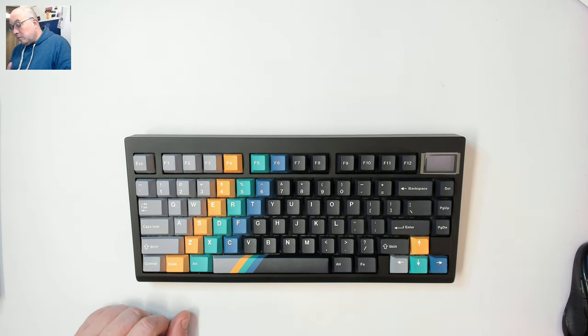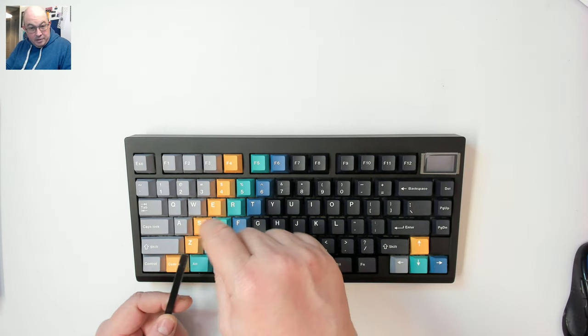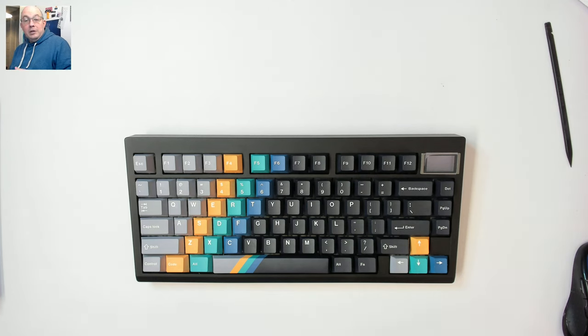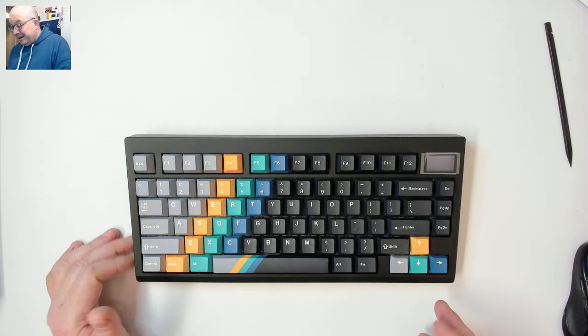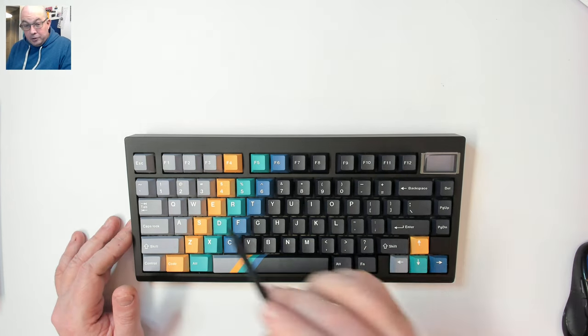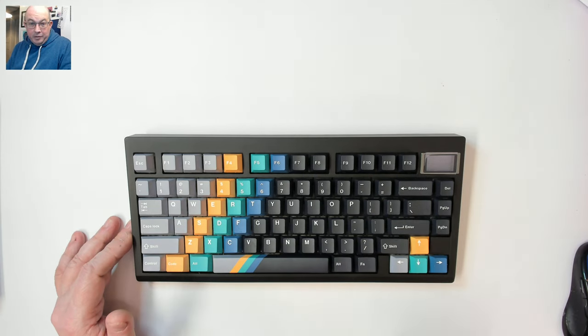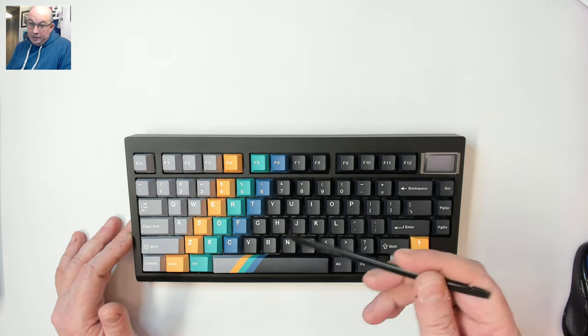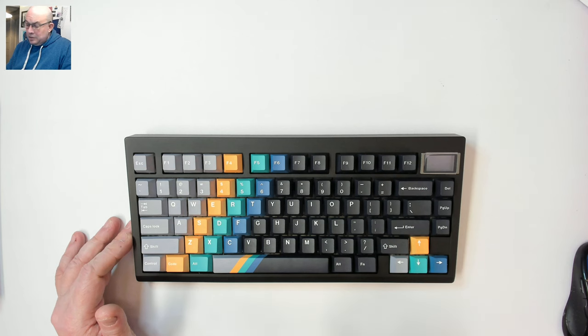But so that you can support the back of the PCB, especially the first time that you put switches in it. I mean, afterwards you want to switch them out, I think you'll probably be okay. You might have to use the flat end of a spudger on some of them to bring up the plate, but you're already going to have those holes punched out. So it's going to be a lot easier moving forward to get switches in there. So, like I said, probably best first set of switches you do after punching out the middle post with something plastic, not something metal. You don't want to go through and poke too hard and get to the battery, which is right around here. Something plastic, you don't have to worry about it, and it really doesn't take that much force to poke through that plastic.